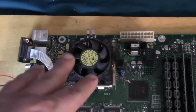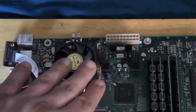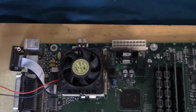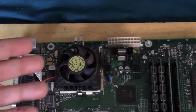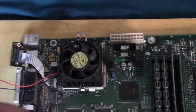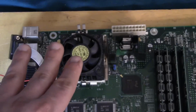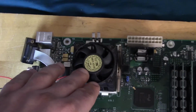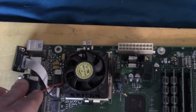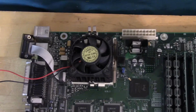But in my personal experience, I found the bulk of DOS titles run just fine on the earlier Pentium. So Pentium 75 all the way up to 200, 233 megahertz. I've had very few games, at least from the 90s, that have speed issues. Of course, you have your Wing Commanders and games like that that are known to have speed issues, but I think overall you're fine with a Socket 7 Pentium as a nice jack-of-all-trades. It also allows you to do some early Windows stuff, which I might throw Windows 95 on here, and some of those late DOS games. It helps you play them pretty competently.